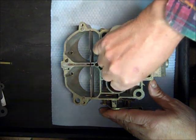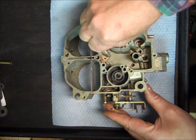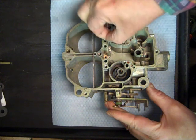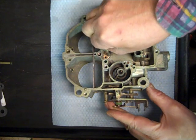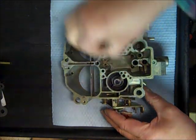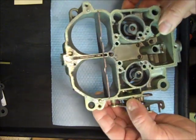Don't get wild with this because you don't want to change the size of the openings. These in particular down here — they're so little — be sure that they're open and there's nothing in them. Of course I blow out every passage carefully, even two or three times to make sure there's nothing in it, make sure it's all clean.